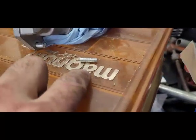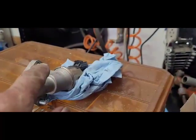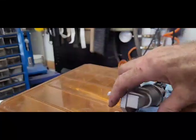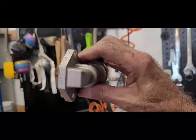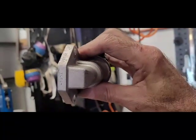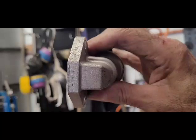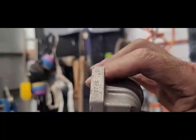The dowels are 5 millimeter, and this one's about 7/8 of an inch — make yours about an inch long. Thread them into the car body or into the air box so they stick out. Then all you have to do is take your valve and slide it over the studs. Leave them about a half inch out, then take one out and put your cap screw in, tighten it enough to hold it still. Then remove the other dowel stud and insert your cap screw. It takes like 10 minutes if you do that.